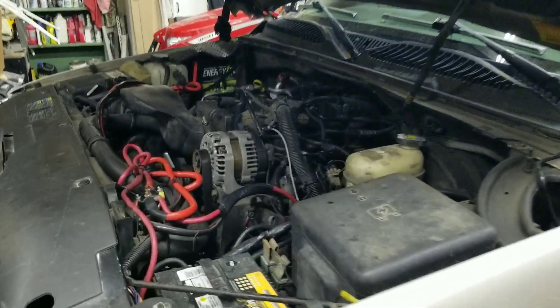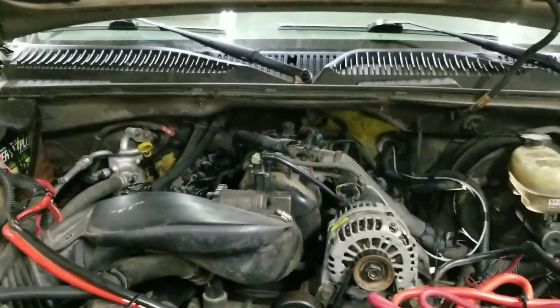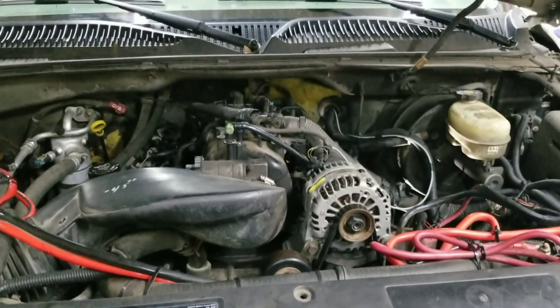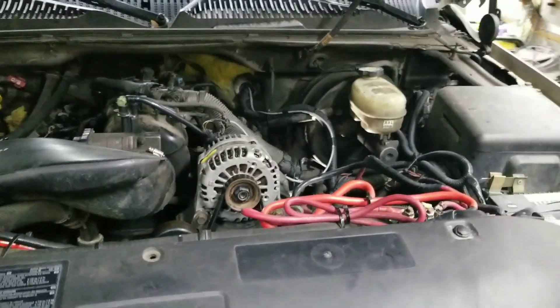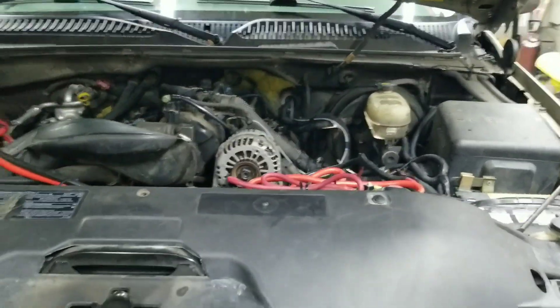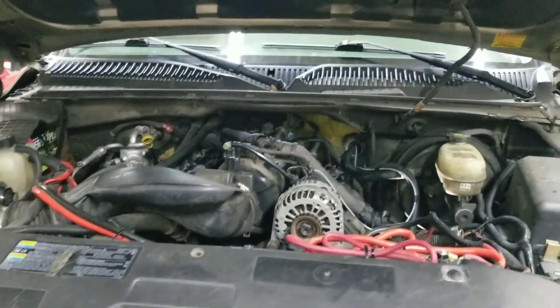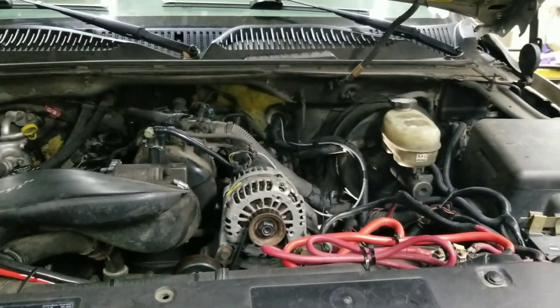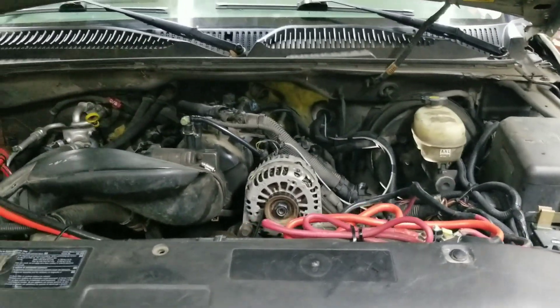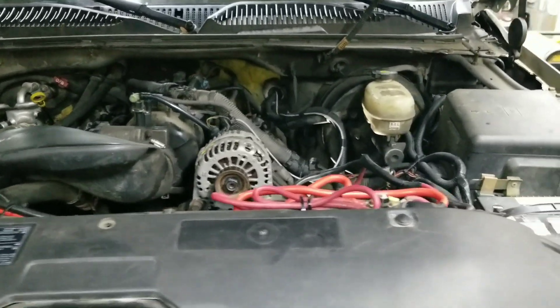Today I'm back in the garage. I have an issue with my truck where under heavy acceleration I'm getting a knock or valve clatter, only under heavy acceleration, and it seems to be lacking a little bit of get up and go. I've taken my diagnostic scan tool and had it in the vehicle while driving. I'm getting some misfire codes but they're random — it's the P0300 — and I can watch specific cylinders misfire but it's not one specific one, so it's something common.